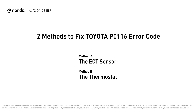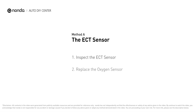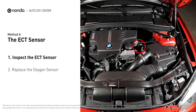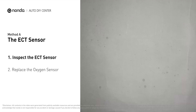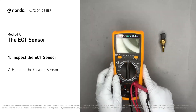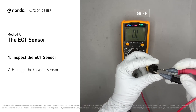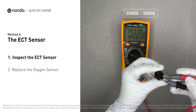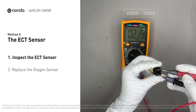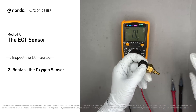Here are two of the most practical solutions to fix Toyota's P0116 error code. Method A: the ECT sensor. In most cars, the primary ECT sensor is installed near the thermostat in the cylinder head. Remove the ECT sensor from the engine. Use a multimeter to test the ECT sensor. At an ambient temperature of 68 degrees Fahrenheit, the sensor resistance should be between 2,000 ohms and 3,000 ohms. If you do not get a reading, this indicates that the ECT sensor is faulty and needs to be replaced.